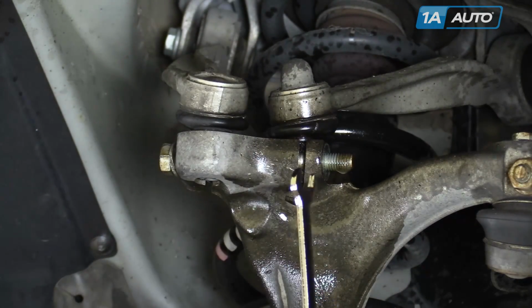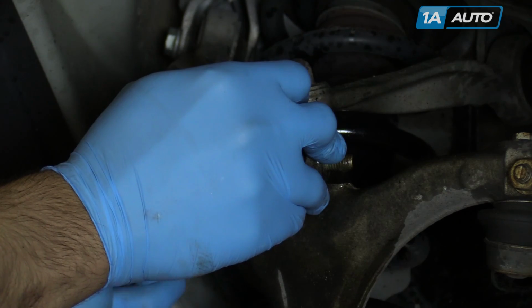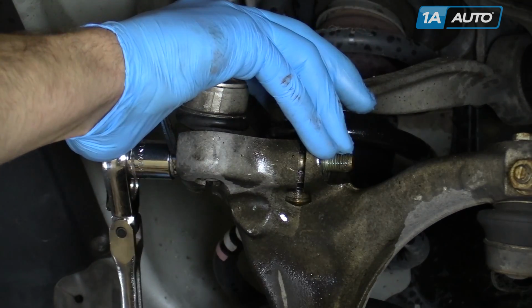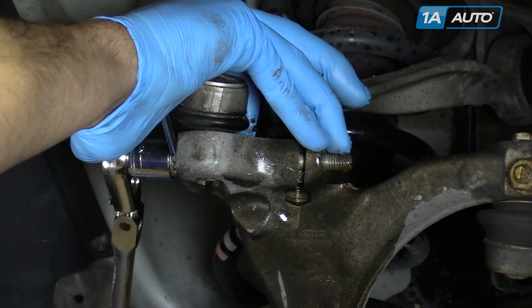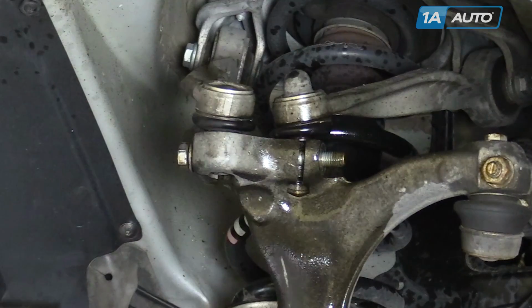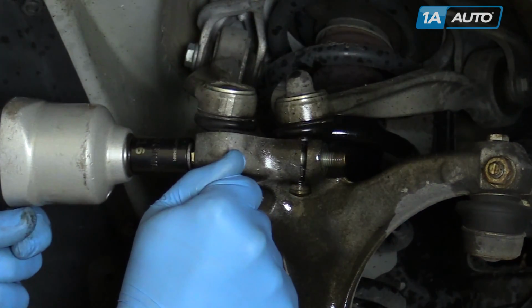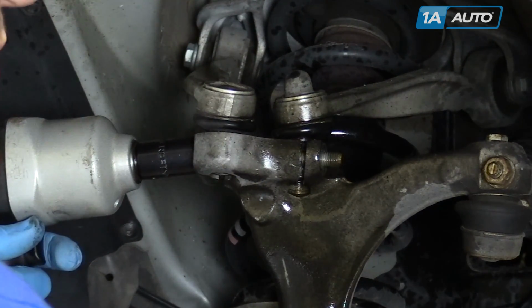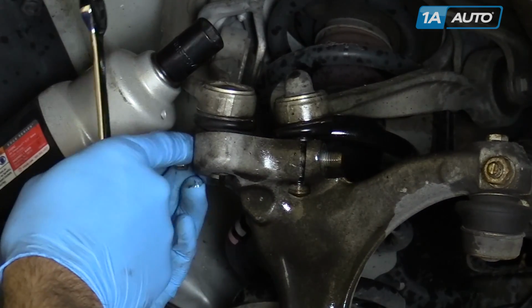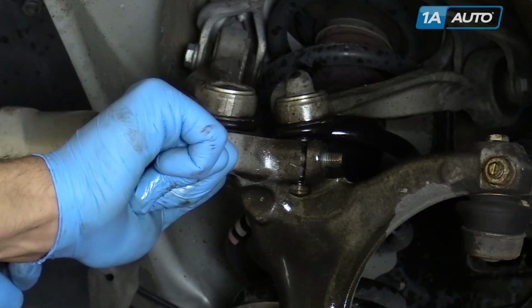We're going to be using a very thin wrench to get behind the washer, pry out on the bolt while we turn. When all else fails, you may just have to use power tools. As the gap behind the washer gets bigger, you can upsize wrenches or even double them up to fill the gap.